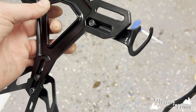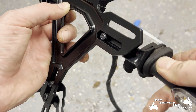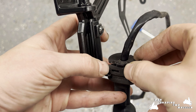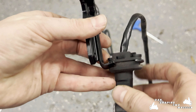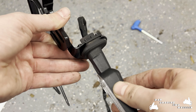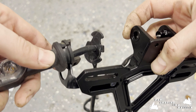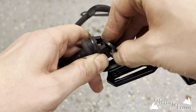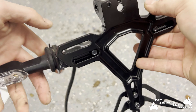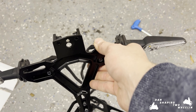Now we're going to fit the indicators into the new holder. We'll take the right indicator — that's the one with the white connector — and slide that in here and give it a little twist. Once done, we take the plastic that we removed from the unit and slide that back into those little points there to hold it temporarily. We'll do the same with the left hand side — just rotate that, pull into place, and get it into the rubber. They're now temporarily on here and something is going to clip over these and hold them in properly in the next step.